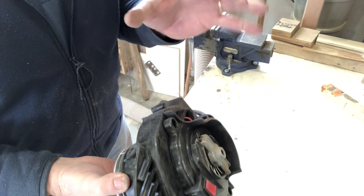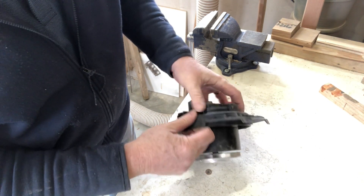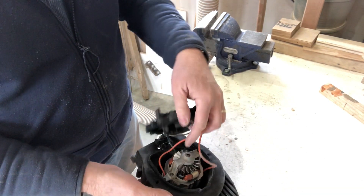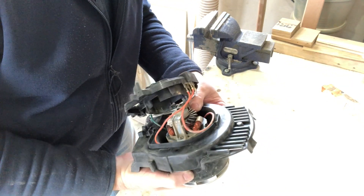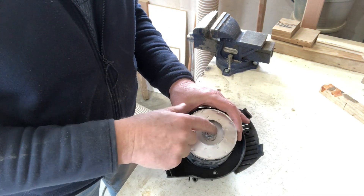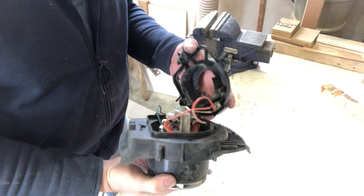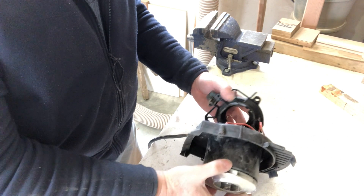So I'm going to take it apart even further yet. I've removed these two screws and I can see now that the whole piece comes apart. So some bushings in here are going to require some lubrication, and there'll be a bushing down there too. We'll take off this nut here and see if we can get the motor to slide right out and give it a full service — probably blow out everything in here too, because I'm sure there's dust all over the windings.